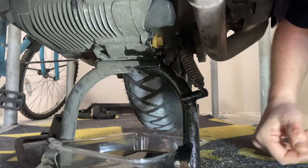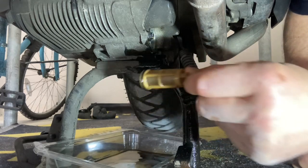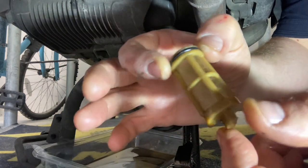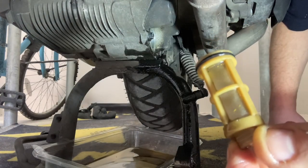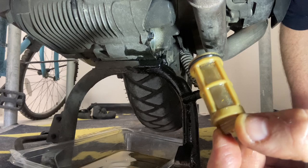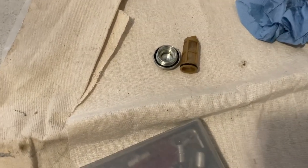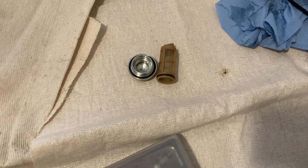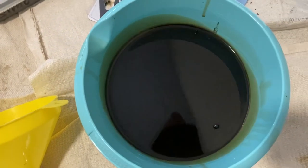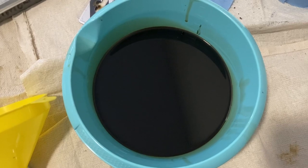This is nearly finished emptying. Here is the little magnetic filter we want to take out, and what we want to look for is any little bits of metal that may have come from the engine as it was breaking in. As you can see there are some tiny spots but it's actually really good — nothing that looks nasty. We'll give it a wipe and then look at taking the oil filter itself out. Here's our old oil ready to be disposed of.